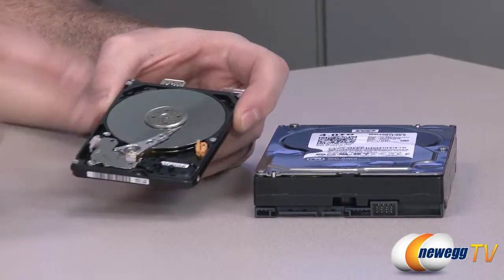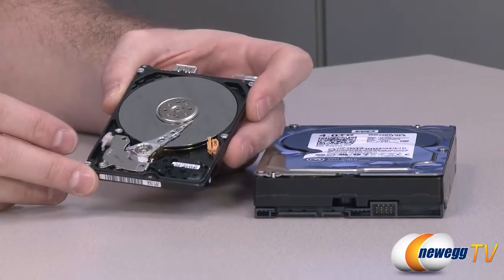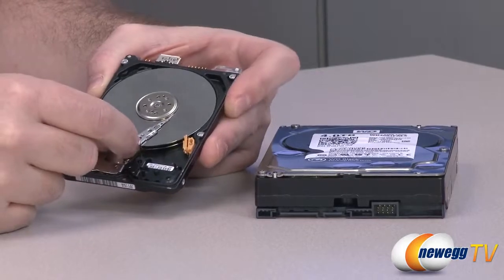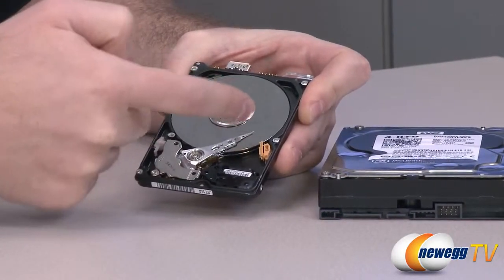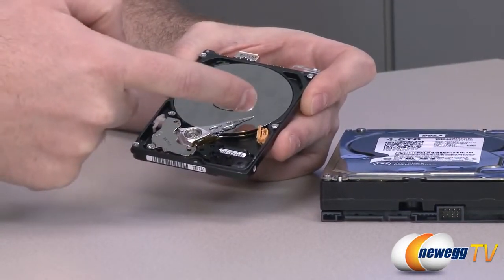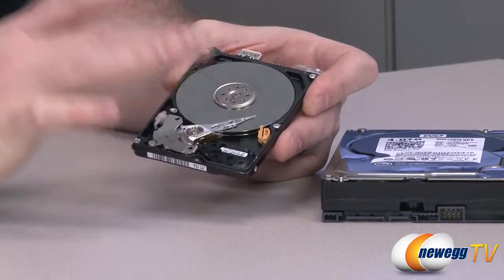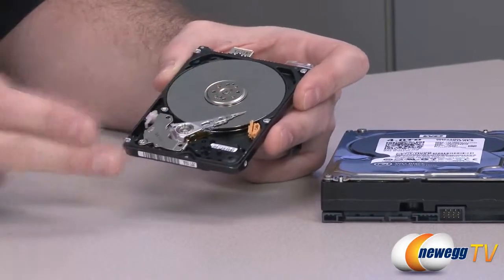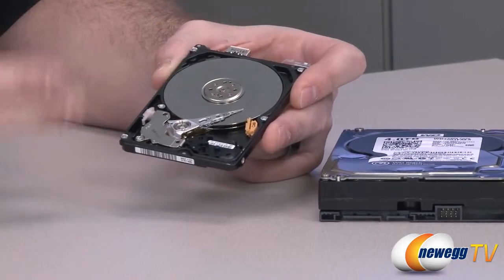One other thing to mention is some technology that's been integrated into the WD Black series, and that is Western Digital's dual actuator technology. Basically, apart from the actuator here that you have, which is handling the movement across the platter and seeking to the specific tracks on the platter itself, you actually have an additional actuator that's a smaller one towards the end. That's going to allow the drive to zero in on the target track more quickly, gives a little bit more play on the end, and that can actually do smaller seeks without moving the entire assembly pack.